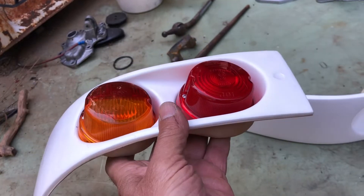You can see what I did here — I had some eighth-by-three-quarter bar stock aluminum from the local hardware store, leftover from making a bracket for the Mini Moke. I started eyeballing how I could force these fiberglass housings into the right shape and get the right curve on them. So I made this aluminum bracket, very carefully lining it up — it's a bit off-kilter because I take advantage of the locations of the mounting screws for the light fixtures. I designed it such that this curve right here, this section, and this very special alignment forces the fiberglass to open up a bit. I very carefully trimmed this end such that when you tighten that screw down, that little tab locates it perfectly to the contour of the body.